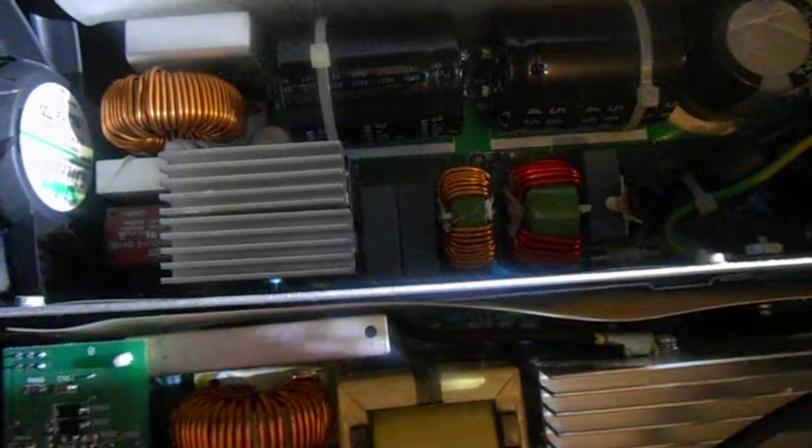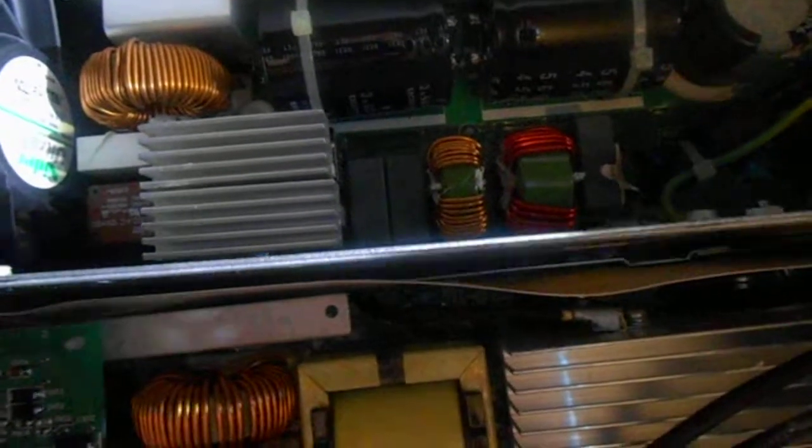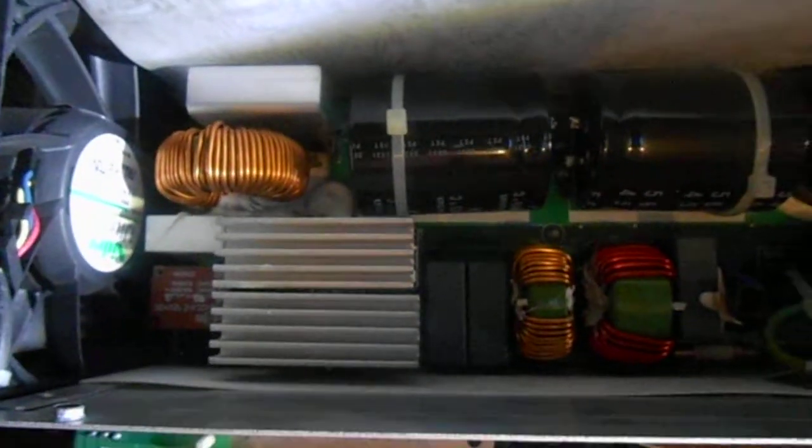So that's why they have two of these. On some servers they have 4 power supplies. This one has 2. They're really heavily built, so if one dies, you've got another one. You go hot swap it out for a new one ASAP. You wouldn't just leave it running on one power supply. You'd swap the other power supply out immediately, and there'd be like an alarm or at least a flashing indicator light to let you know there's a problem, as well as an error message thrown up on the network telling you, through the software you're running to monitor faults and things like that. Though these are massively built.